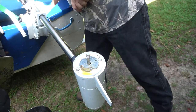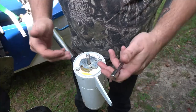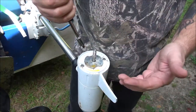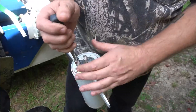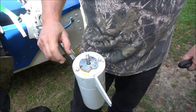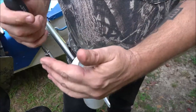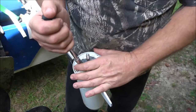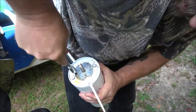Usually when they're tight, and you've got no way to get to the threads of the bolt or screw or whatever you're taking out, that stuff normally doesn't work, man, unless you let it set for weeks. You see them guys on them restore videos, oh, I can't get it, and then it comes right free. That doesn't happen. But if you notice, the head of the bolt is always wet, but the threads aren't. That means the penetrating fluid can't get to it. Sometimes it can't.